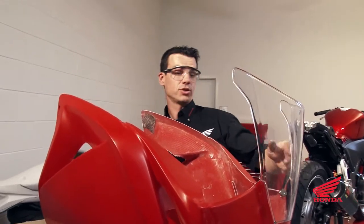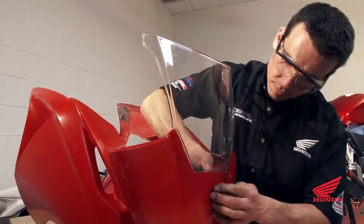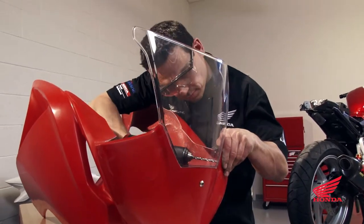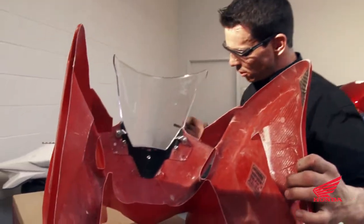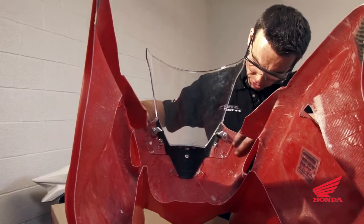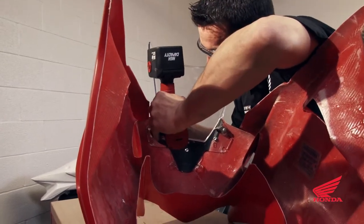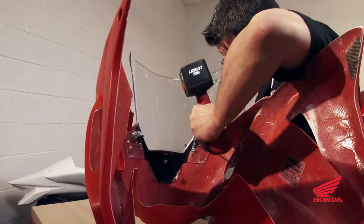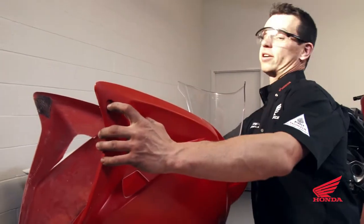Go behind and drill your holes. On the inside you'll see where the stock windshield sat around the front birdcage of the motorcycle — use that as a reference to drill the holes to mount the bodywork to the bike. Center your drill and drill your holes. Your bodywork is going to bolt onto the bike here, so drill your center and drill your holes.